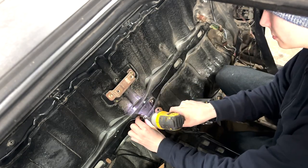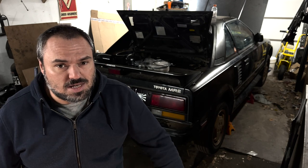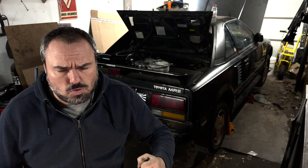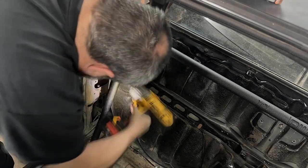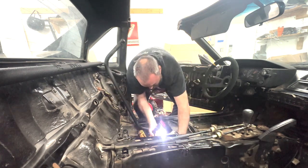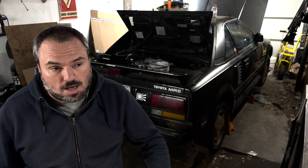Miles got to business taking out the entire center console. I've read that it can be retained with this bar, but I don't need a center console — it's a race car getting tractor parts put on it. After removing the center console, you should pop out your seatbelts, because race car. Once you remove the cover that gives you access to the seatbelt reel, you can get a 14mm socket on there and pop the reel out. Then take off the top cover from the plastic where the seatbelt comes out — you'll find a split in the plastic that you can slide the belt through. Now you should be able to remove the entire seatbelt. The female end of the belts also comes off easily from the tunnel in the middle of the car — another 14mm bolt and it's out. You may have to unplug it from the seat; there should be a plug that goes to a harness underneath supposed to ensure your seatbelt is buckled.